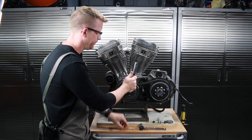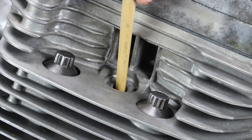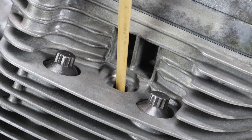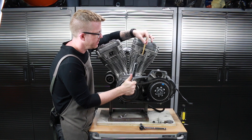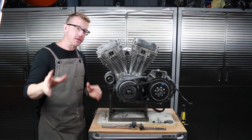You can hear it. I'll take my paint brush — that piston is way down in there. Up she comes; we may have gone a little too far. There you go, that's top dead center. Real easy to find.